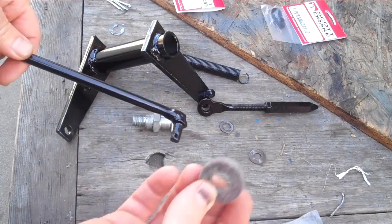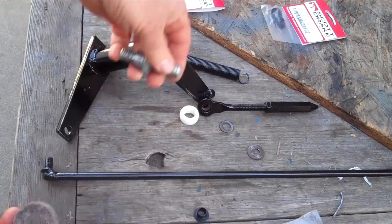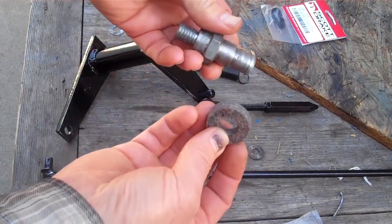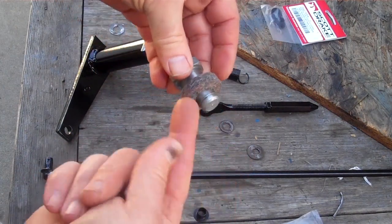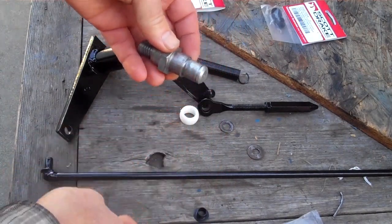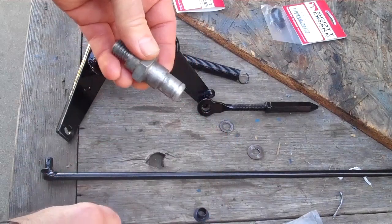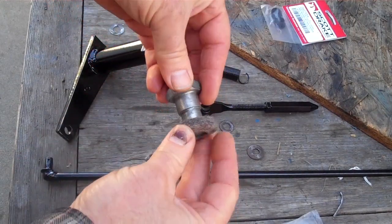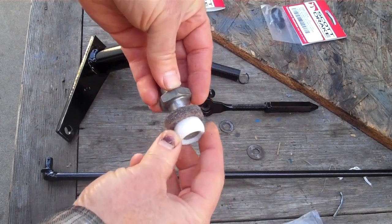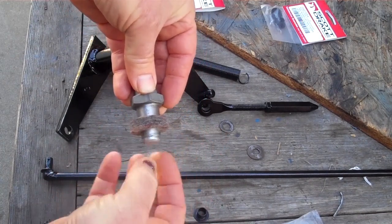I had purchased the felt washer for the linkage that goes right in there, that sits in there. I had purchased the washer to go over that, but I realized that was for a Mustang, which does not have this built-in lip here. That lip is to keep the bushing right where it's supposed to be. When you have a pin that goes all the way back against the nut there, that's when you need the felt bushing to keep the nylon bushing from moving around.